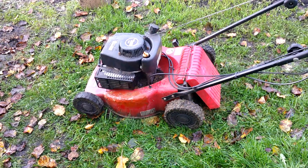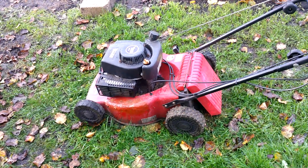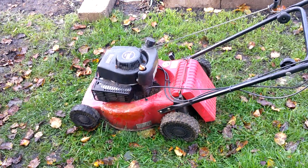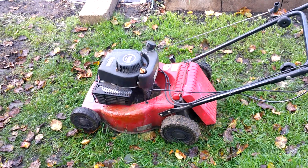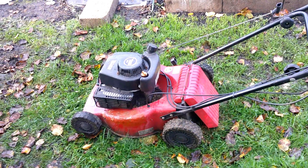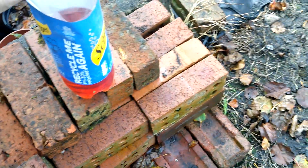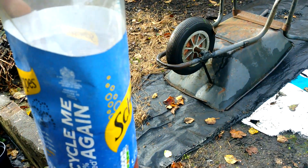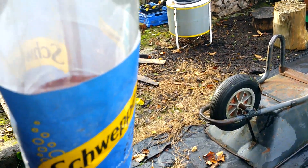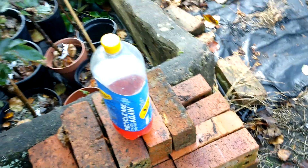It should start up no problem at all next spring when I come to start cutting the grass again. So yeah, just a top tip there: if you've got power tools whether it's two-stroke or whatever, you definitely do not want to leave the fuel in the tank — get it drained out, otherwise there's a risk it'll gunge your carburettor up. That old fuel I've just drained from the lawnmower and others is all two-stroke from strimmers and what have you — I just tend to keep that because it's handy for when you're having fires.